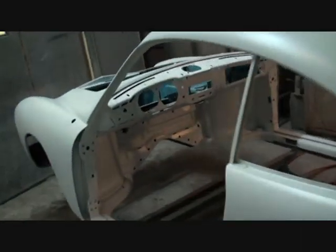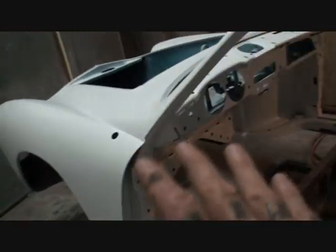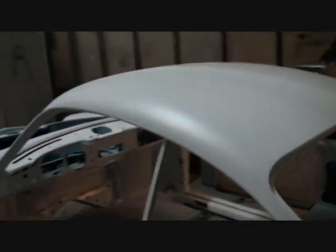Now, I was telling you about the sealer. If you look right here, okay, this particular car, this is a 1973 Karmann Ghia, is completely covered in white epoxy primer, see? This has been stripped down to bare metal, and then I put epoxy primer on it to seal it. We're going to use the same type of sealer on our guitar. We're going to put one nice good coat on it, and that's it. Now I'm also using white on my guitar because I want the gold to pop out, see? If you have a bright color, always use a white sealer.